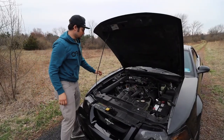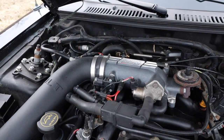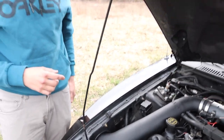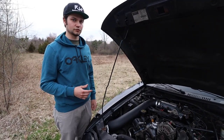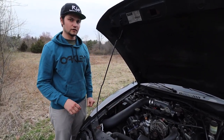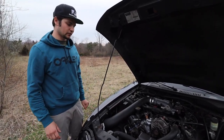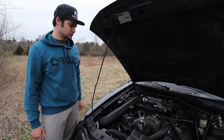Let's pop the hood and dive into the engine bay. Starting at the top, this is a 78mm BBK intake plenum — I'll put that in the description — which allows a lot more airflow than the stock plenum for the car to breathe better. It's paired with a JLT intake mentioned in our reveal video. For the cams, the tuner recommended this intake due to the bends in the pipe, which makes it a lot easier to tune the car. It's sleeker and more appealing than the old aluminum SR Performance intake I had before, which was getting corroded.